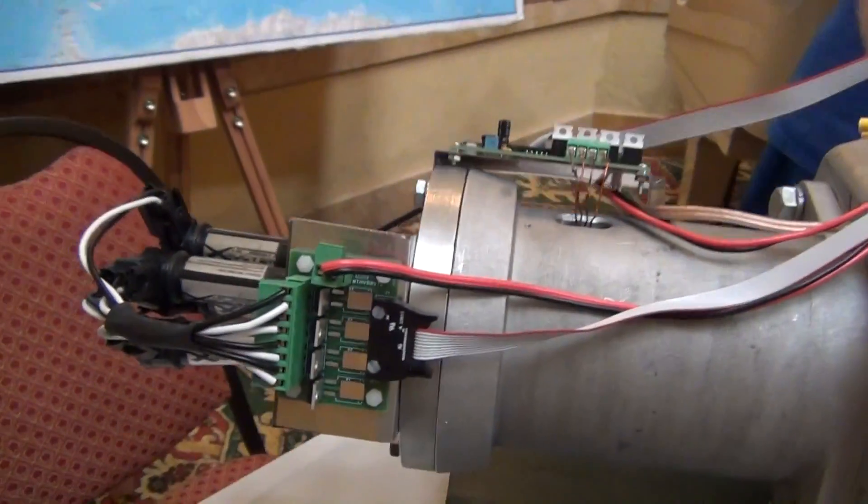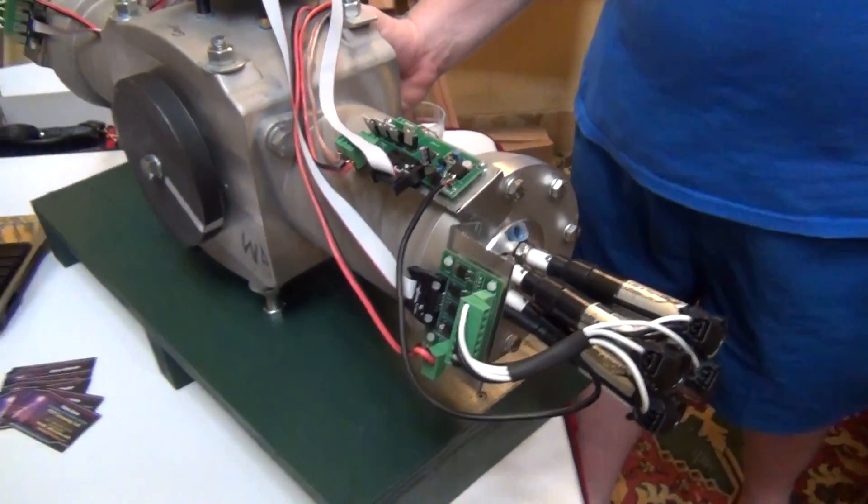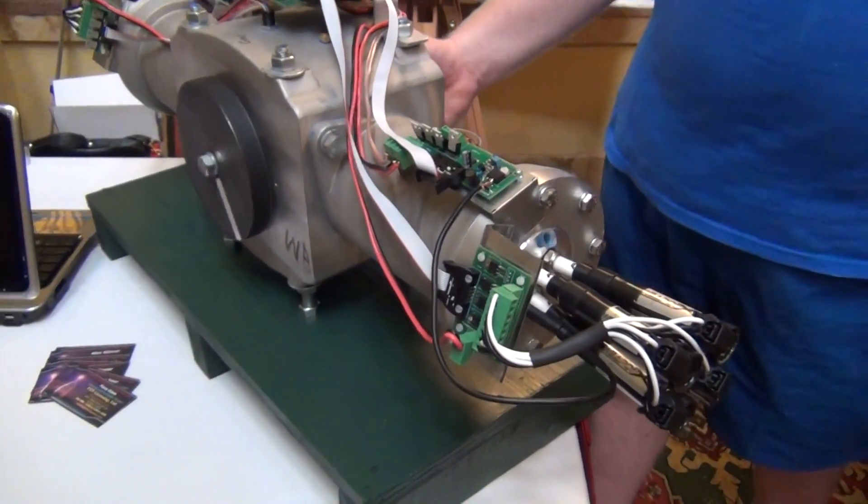So you have two pistons. We didn't reinvent the wheel — we used a Harley bottom end. It's a Harley? So this is a highly modified Harley bottom end. We detuned it by putting a smaller power shaft on it, and that's because we want this to be the demonstration of the technology, not one that is sold for a purpose. That's left to the manufacturers that we license.